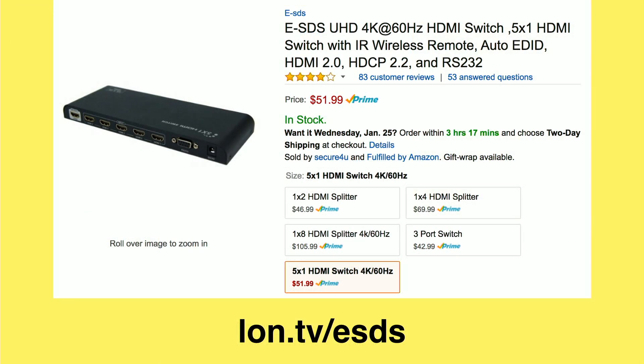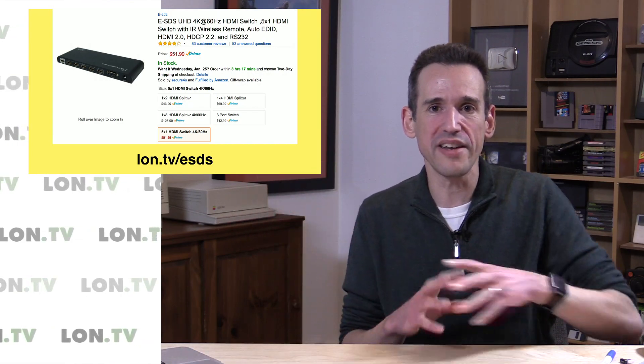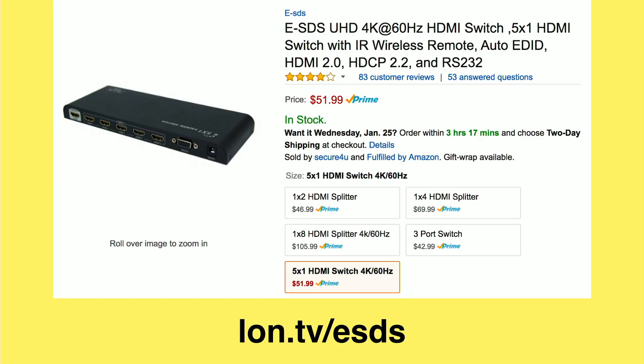I did find one here — I haven't tested it, so I don't want to recommend it just yet. But if you're daring, this one at least on its specifications meets all the things I'd be looking for in a switch box: 4K at 60Hz, HDMI 2.0 which supports that frame rate at that resolution, and HDCP 2.2 — all the things you want. It costs about $52, so you can see how cost escalates. This one claims to support 18 gigabits per second, which is the latest you'll want to look for in HDMI content, especially with new HDR video coming that can do things on a frame-by-frame basis. It's kind of crazy what's going on right now with video formats.